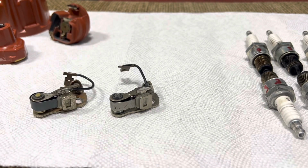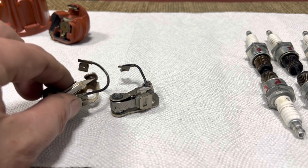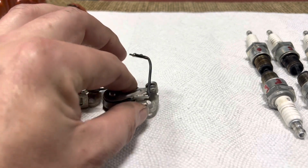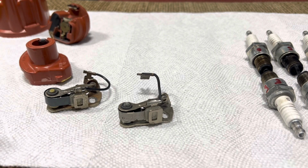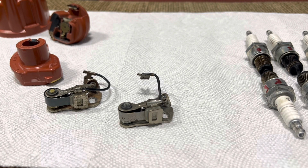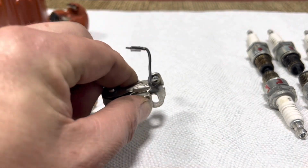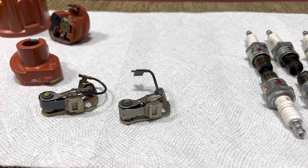So this one particular car, we've been chasing it for 4 or 5 years now. And another couple of cars, it doesn't seem to matter how you put power to that MSD box. And because the MSD boxes go bad themselves, it's not just the fact that it's wearing these components out rapidly, right? I mean, you should change these maybe at 20,000 miles, maybe 15. But we're talking, I think there was 3,000 to 4,000 on this set, and then maybe another 3,000 on this set. So overall, for a collector car, not horrible, but still something was not right. So we've made it right.